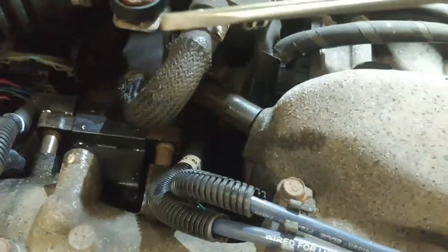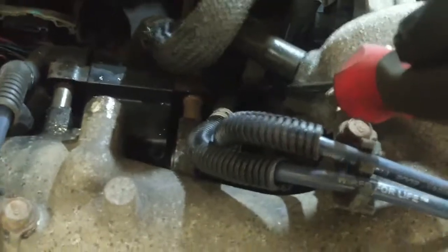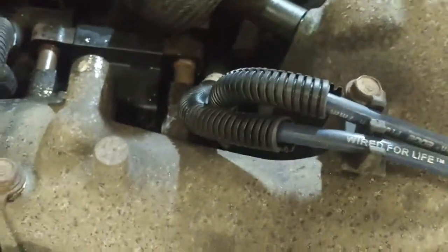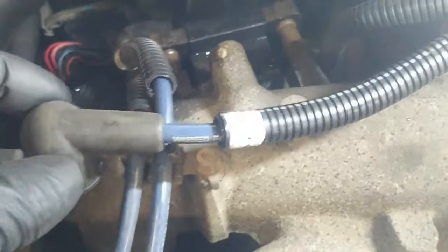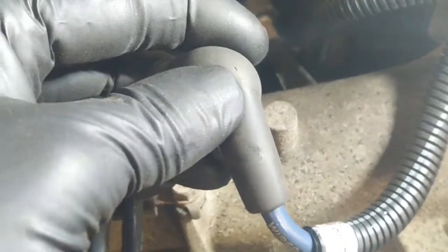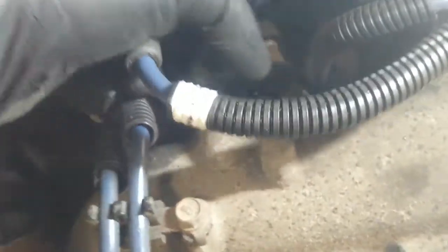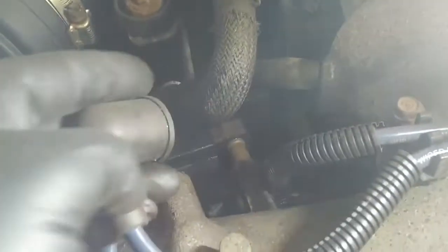There's definitely something happening down there. Let's take a grounded screwdriver. You can see that spark plug wire is leaking — now it's stopped completely. Why would that plug wire be leaking? It's a brand new wire. Well, we'll take it off and have a look. I took that number two wire off and dried it off, and if you look there's a little tiny pin hole in the wire right on the top of the boot. That was arcing to a vacuum line, and of course if the vacuum line is wet, it'll be conductive.